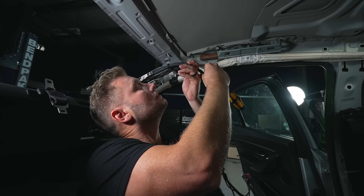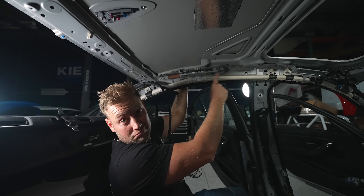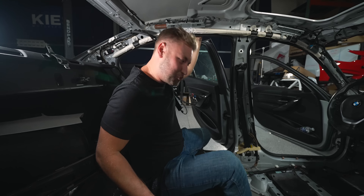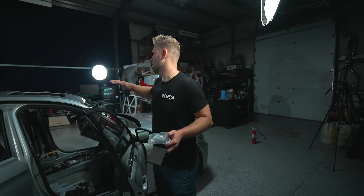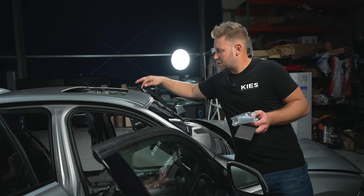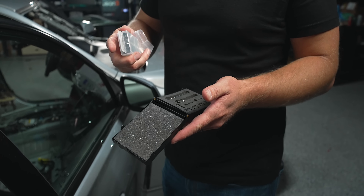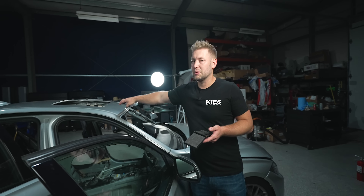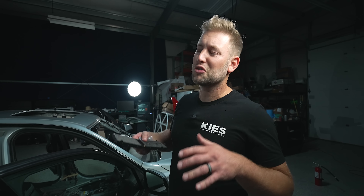Look, here are the rear drains — not clogged. So we're going to start drilling. I'm definitely going to be super careful because this is an airbag right here — I definitely don't want to hit that. Now, the roof skin isn't structural, it's just a piece of sheet metal that's spot welded and then glued down. They do make these special bits that I got — some people say they work great, some say they're awful. What they're supposed to do is help you drill through just the top layer. If this doesn't work, we're just going to go to regular drill bits and my grinder. We also have some power tools we bought just for this job which we are super excited to use.